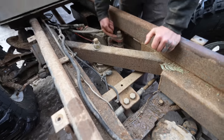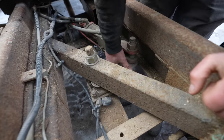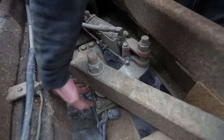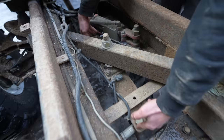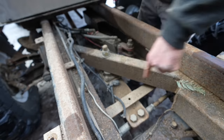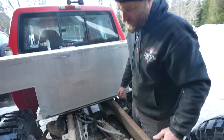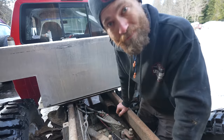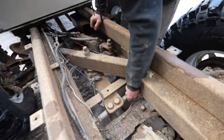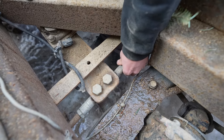The RAM here pushes on this aluminum arm that is bolted to this bearing and this big old steel arm, which angles back and forth and runs both axles at the same time. Kind of a cool setup, just needs a little bit of improvement — maybe some tightening of things. This jam nut on the tie rod is just finger tight.